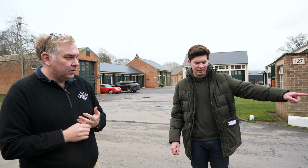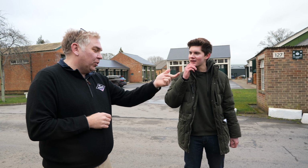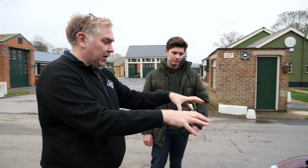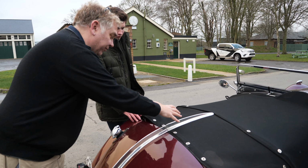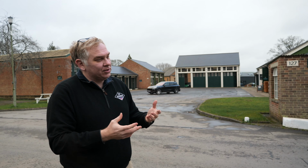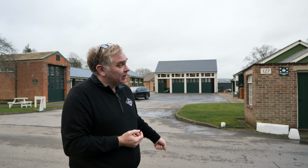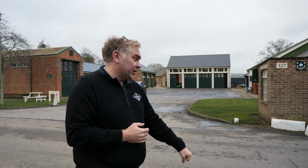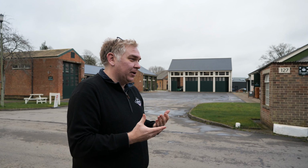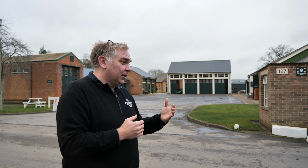I remember you mentioned the battery cut off, is it in the engine or what? Oh, underneath. So the batteries in this car are mounted underneath the seat here. So if you need to jump start the car, you can jump off the engine, but it's a bit of a challenge, so you'd have to take all the kit out. So we then fitted an Anderson plug underneath the seat, so we can, but it's hidden, it's not a plug on the side.